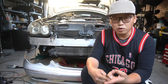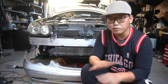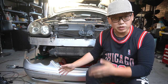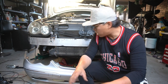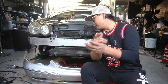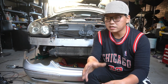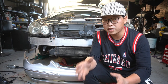It's going to make changing headlight bulbs a lot easier because you can remove the headlights, even though you do not have to remove the front bar or the headlight in order to change out your light bulb. It's just going to make it easier. Also, it's going to give you access to the fog lights as well and anything attached to the front bar such as the ambient temperature sensor, the horn and so forth. Removing the front bar is actually pretty important if you are a DIY-er and you like to modify your own car.